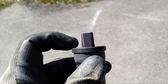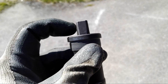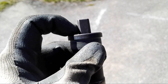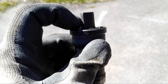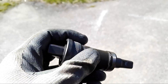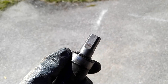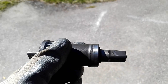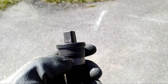Looking at the drive side end, there's really not much room here because the crank goes almost all the way, and I would need to find room for the plastic disc that holds the magnets between the crank and the flange. So I'm thinking there might be more room on the non-drive side, and I'm going to try to install it there first. If that doesn't work, I'll try the other side.